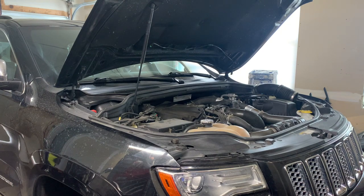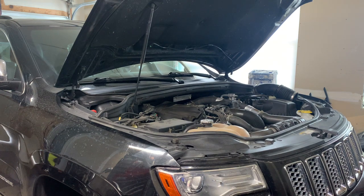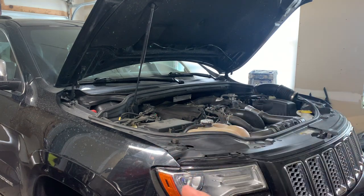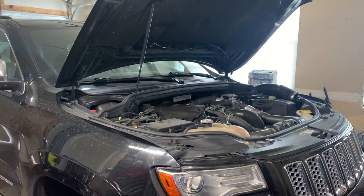So we already talked about fuel a little bit. Another thing that you need to do on diesels is change the fuel filters often. That's because on a gas engine vehicle, the gas doesn't really do anything. It just goes from the tank, gets injected into the engine and burned. But on diesels, oftentimes the fuel is pressurized to a very high pressure, sometimes 15,000 PSI, in small amounts and concentrated areas. Because of that, the pump and injection system are elaborate, complicated and expensive. So it's really important to keep diesel fuel clean and well lubricated.